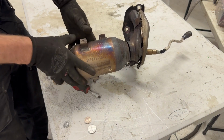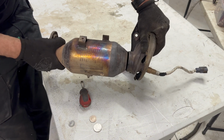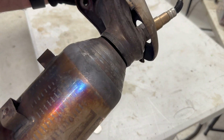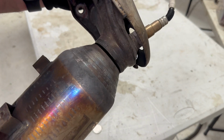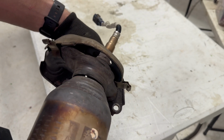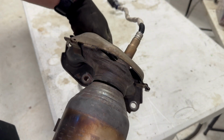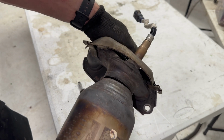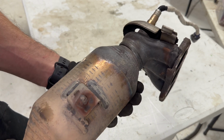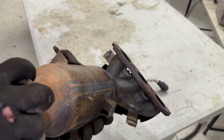Might do it. I think this has happened obviously from trying to move it around, but it's definitely a weak weld and likely to be where the exhaust was leaking. So I'll get that welded and refit it. There's no way that just taking the exhaust off and trying to get the cover off should make that break off. So I think that must be where it was leaking from, at least to some degree.